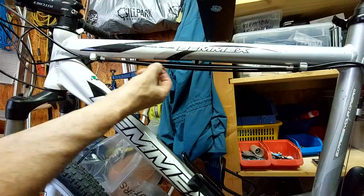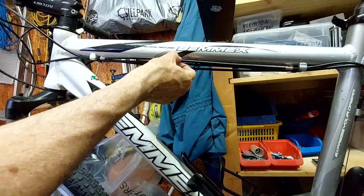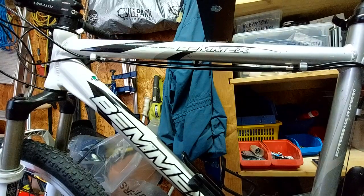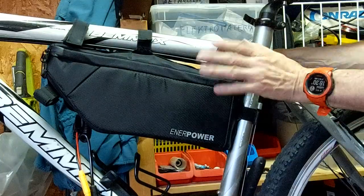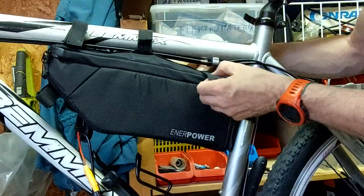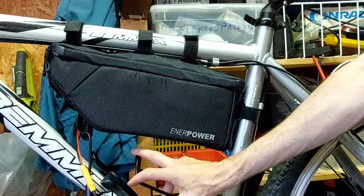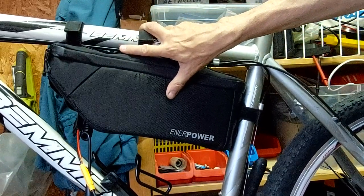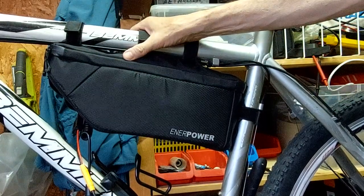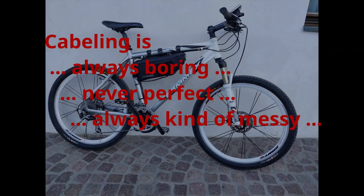Right now you can also see on this side the replacement cable cover which covers the gear shift cable. It's a nice cable. Now I can bind it to the frame. Now it's time to get the battery in. The battery is already fastened here and here — the straps are flexible. I prefer this frame pack battery to a frame-mounted battery because this is quite a heavy piece — about 20 amp-hours, so around 700 to 800 watt-hours, and it weighs about three to four kilos. It provides endless power.